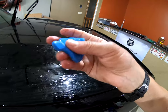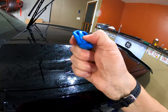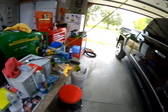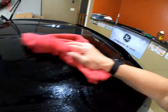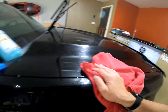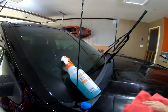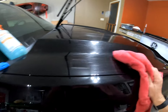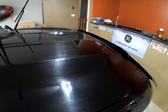There's a little dirt on here. This piece of clay should last the whole truck — what you do is knead it inside itself, make it flat again, and go through the whole vehicle. I'll get a microfiber towel, go through and wipe this down, then work through the whole vehicle this way, including the glass. Probably the biggest place you'll see contaminants picked up is on your windshield. I'll try to show a piece where I can actually see the contaminants and show you what happens to the clay.